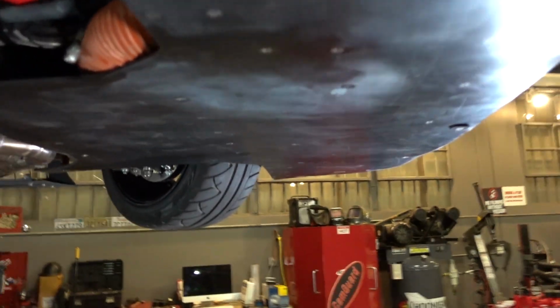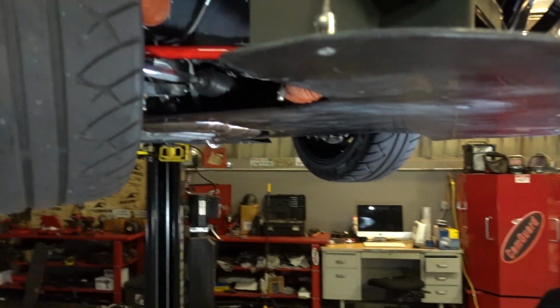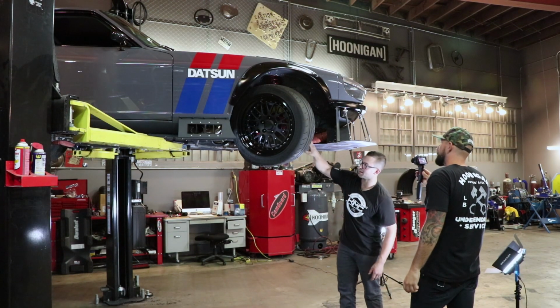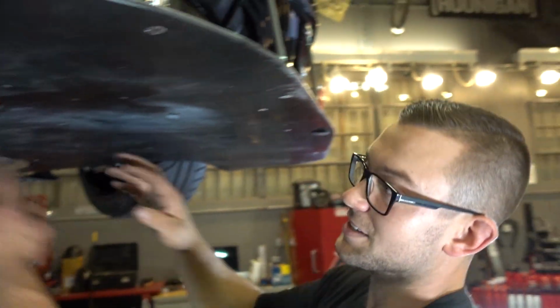So your ducting gets a little bit more complex, huh? It does. Because it comes in through the front, and instead of just kind of finding a way right in here to fish in and then go to here, you have it going through the body. Yeah. It just made more sense when I started looking at it for clearance issues and trying to actually get to where it needs to be able to cool properly, was to do that in multiple pieces. And then, you know, you're turning with this heat tubing on there, and so eventually that'll fail. And this way you can just replace this small section versus this big section, pull the splitter off and all that. So it's all about function.